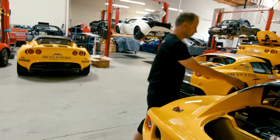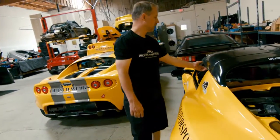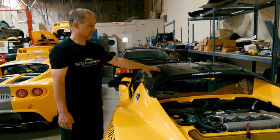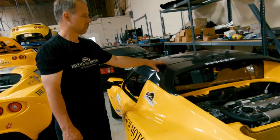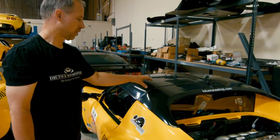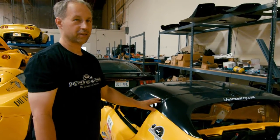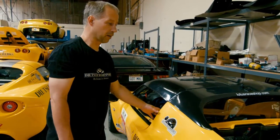At the same time, if you've got a cage in the car you can reduce some weight from the top with a one-piece hardtop. That takes about 19 to 20 pounds out of the top. The factory roof and roll bar cover weighs about 29 pounds, and this particular top is about nine pounds. Our newest top is about four pounds, so that's a lot of weight up high where you don't need it that you can eliminate.